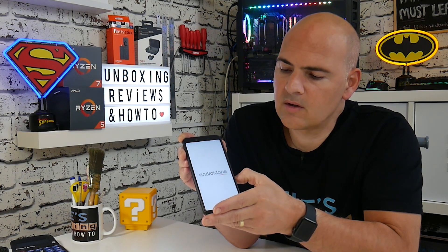To do the hardware reset, press and hold the Volume Up button and the Power button until you see the Android One logo come up. Then release both buttons and wait until you see the Android robot. Then press and hold the Power button and briefly press the Volume Up button, and this will bring you into the Android menu.